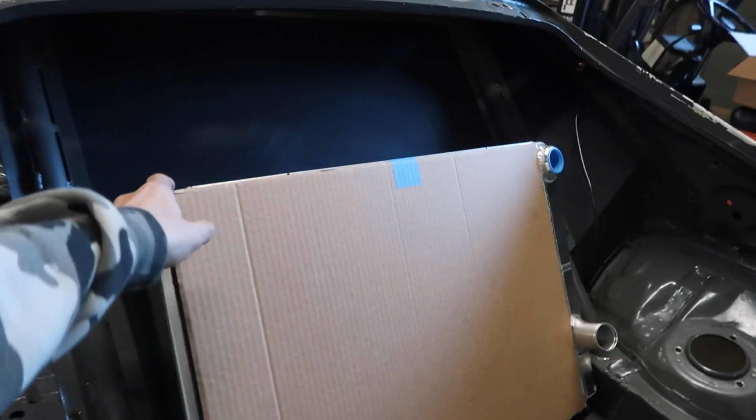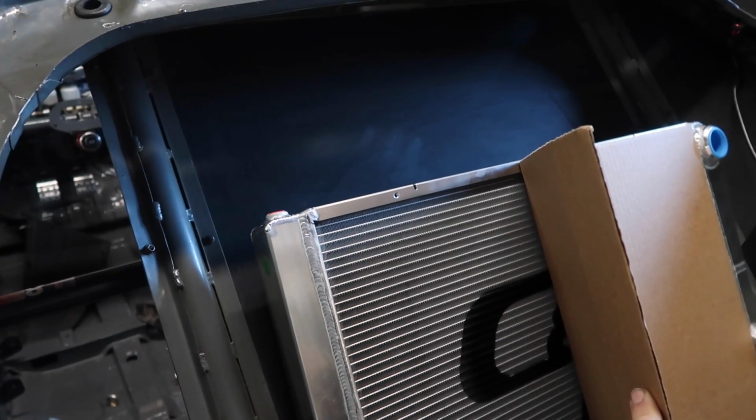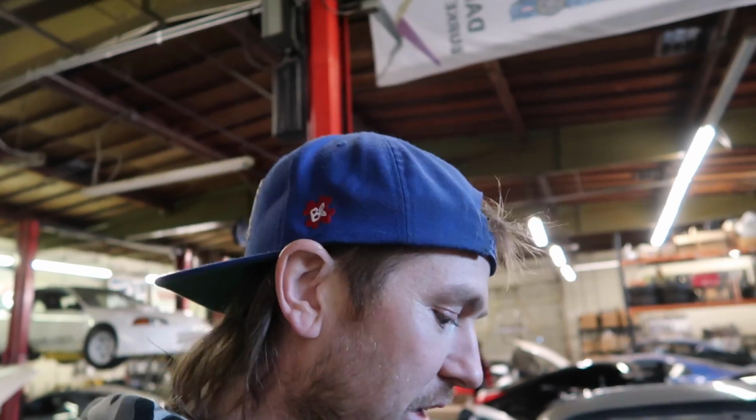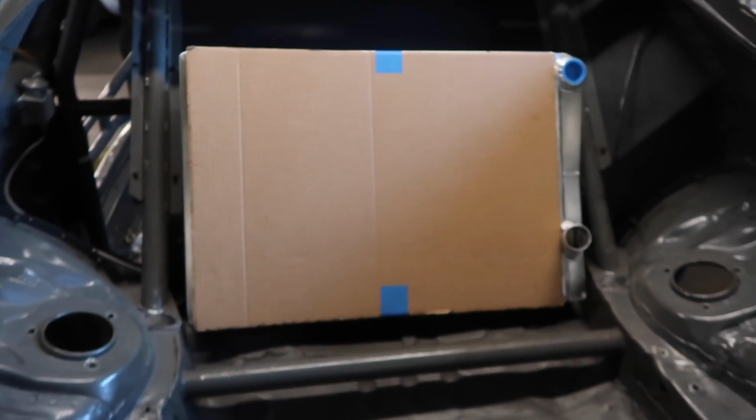This is a new version of a radiator that has extruded cores. It's more efficient. It can be smaller and be the same efficiency as that bigger one. I'm sure my second fan will turn on more times now because it's a little less water. And we're also doing the through the cab water stuff like we told you guys about.